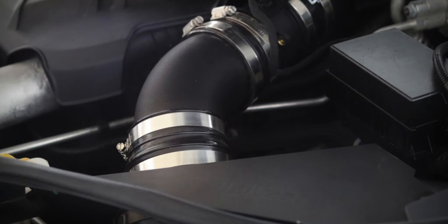Today we're going to install the engine intake onto a second gen turbo diesel for the Jeep Grand Cherokee. This is a 2018 — some things are a little different. One being they've moved the throttle body all the way down, which is far away, so I don't think the stock inlet tube is going to fit properly. I think it's going to have to connect to this other tube here, hoping it'll be the same.